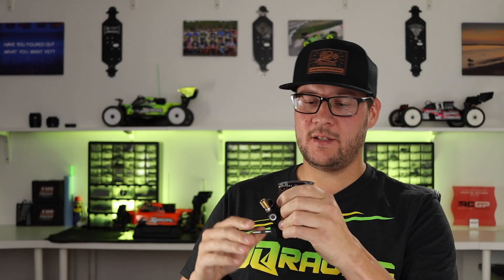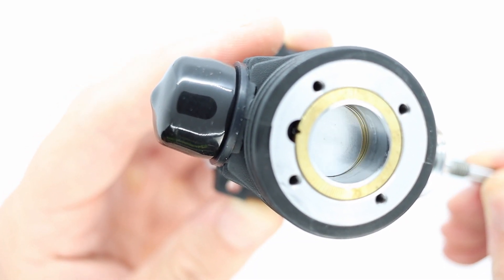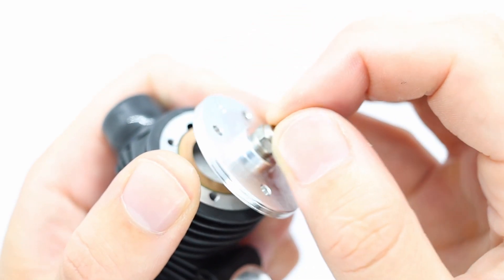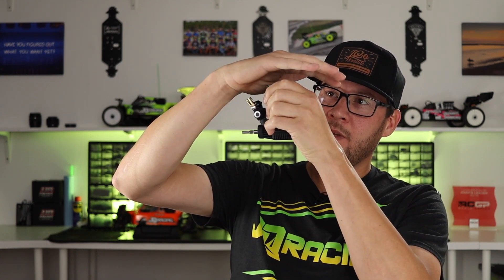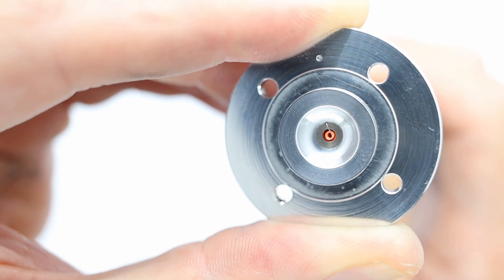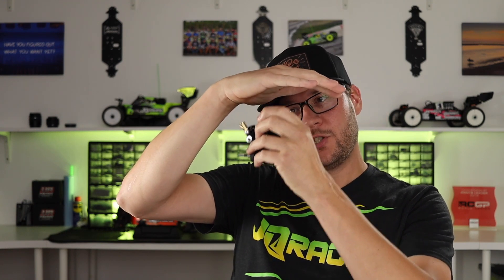Above the piston. So we now have this mixture of air and fuel above the piston, and the piston is moving up. Up above, we have the head button and the combustion chamber, with the glow plug up at the top. So the piston is moving up and it's compressing this mixture of air and fuel. And then right at the top, what happens is the compressed mixture of air and fuel — the oxygen in the air and the fuel — they react thanks to the spark from the glow plug. So what happens is it catches fire, but it's under pressure, so it's actually an explosion. And that explosion pushes the piston back down.